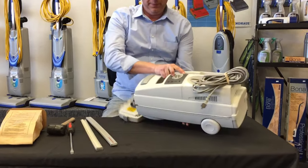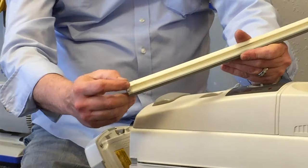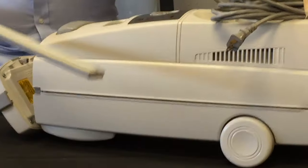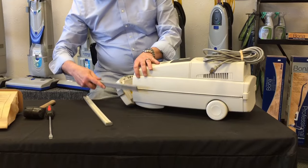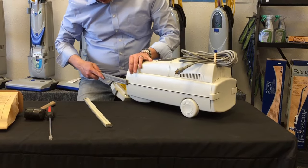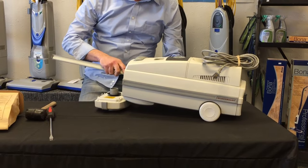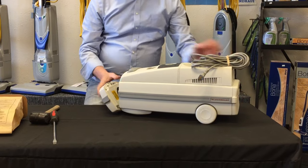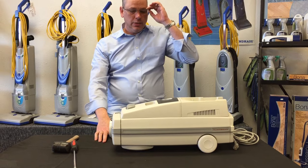When you're done, take a feel of it and the gap should be even across both sides. Once you have that, go ahead and put the slider strips back on. You'll notice right here there are a couple of little dimples — when you slide this down it locks in place and it won't move forwards and backwards. If you think you're going to be going into the unit again, a really handy tip is to take a needle-nose pliers and push those dimples down, because then the next time you need to go in it'll slide in and out a lot easier without so much trouble.